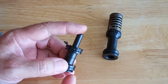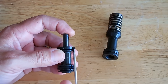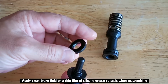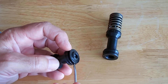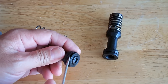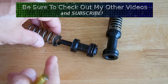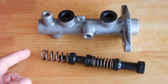If this seal is dried out, when you push your foot on the pedal to generate that high pressure, fluid is going to blow past it and you're going to have a problem with your braking — the pedal could be very low. These seals come off very easily; just lubricate them and pop them back on. Over here is another cup seal — fluid gets over here, makes this side open up and push outward. You also have fluid in between to keep everything lubricated as the piston moves back and forth.